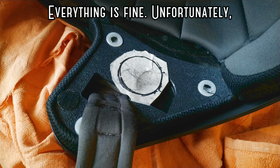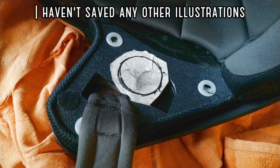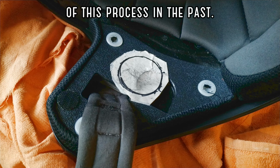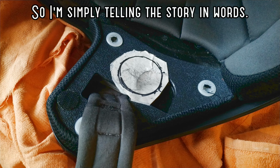Make sure the headphones are seated correctly. Buckle the neck strap. Be careful. The helmet should be in its native position on your head. Now carefully and without fanaticism, move the helmet in the horizontal plane and in a small circle in the vertical, so that the carbon paper forms prints of the headphones on the paper.